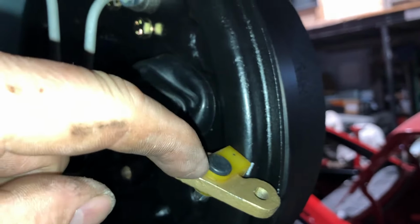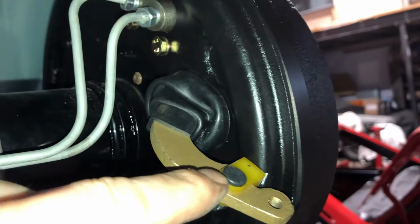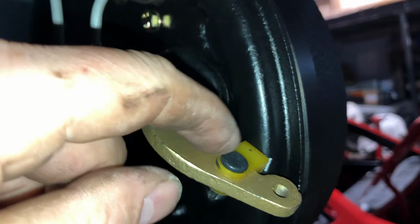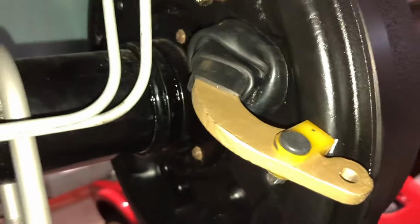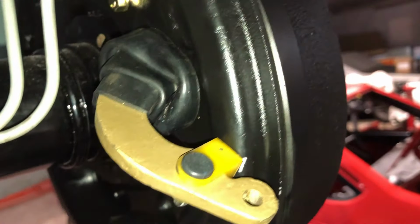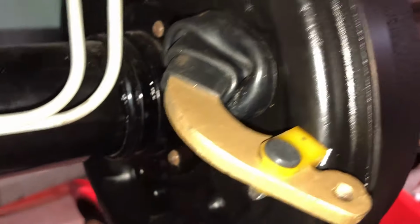Something I've realised as well is that this brake stop was missing the pin. So I went in my little collection and found one in there. And every one of these I pick up second hand is always painted black. So I'm assuming the axle was built and painted as one. I may be wrong, but why would every one of these be black? It just can't be coincidence. The nylon, you still see some of the black paint on it there, I can't get it off. Every one of them is black, and the only piece that isn't is the face that's jammed up against the back plate. So all these concours cars that have got these cleaned up and perfectly yellow or white or whatever, I think they're wrong.